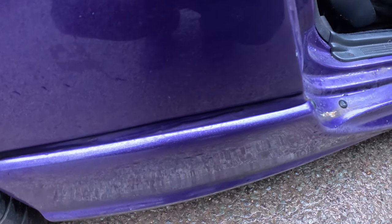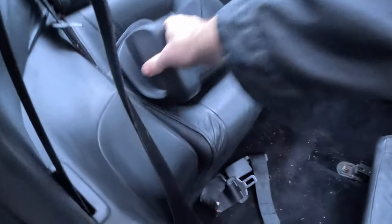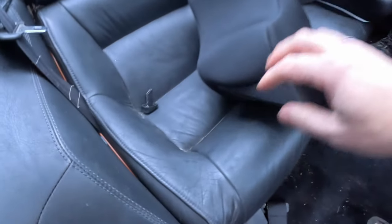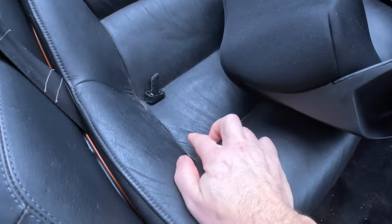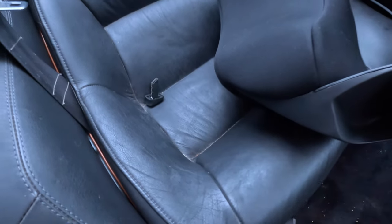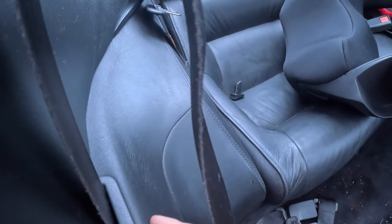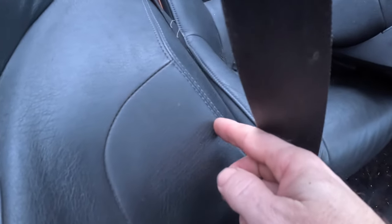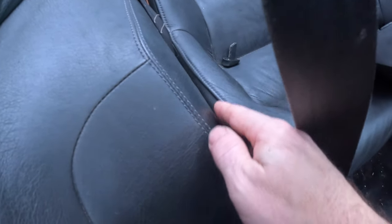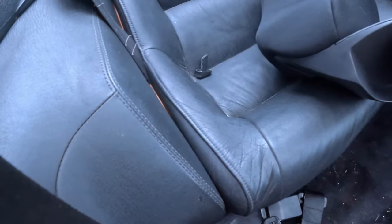So what I've done is I've rerouted it, because under these back seats here there is actually an inspection hole, just under here, where you can take a piece of tape off and you can inspect the gutter. So I have rerouted the pipe so that it comes down here and comes out where the seat belt is, next to the seat belt, under some bits and pieces here, so it's all covered by the trim, and straight out the bottom of the car, so no more rotting.